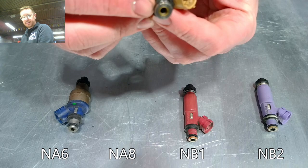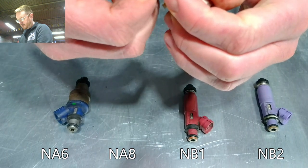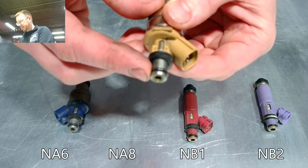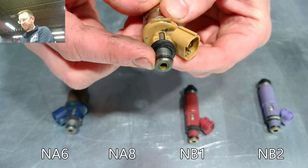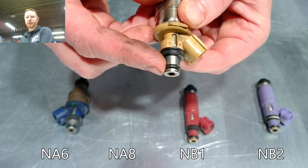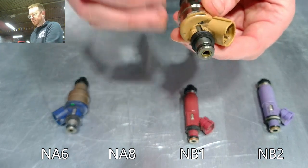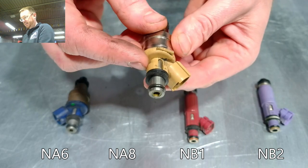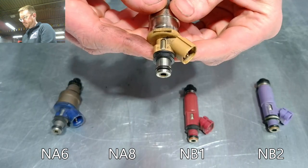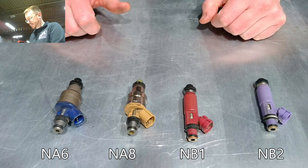The final part is the o-ring on the top — you can just pop it right out. The o-rings are one of the most common things to become damaged. Usually they just get hard and brittle over the years, and when your car is 15, 20, 30 years old and you pop the fuel rail off and back on, they're just not going to seal right. What will happen is you'll get a fuel leak dripping down the injector — it can be a pretty severe leak because it is under pressure, it can actually spray out of there. For that reason, we always recommend replacing the o-ring every single time, especially if it's got any amount of age to it.